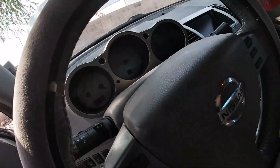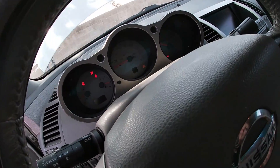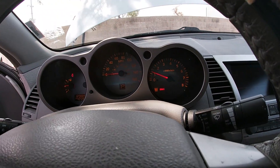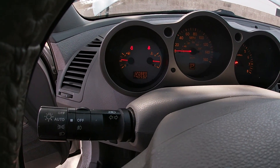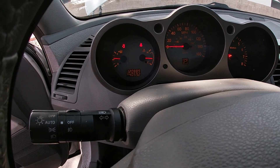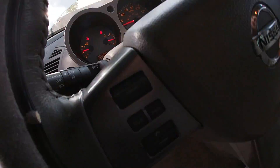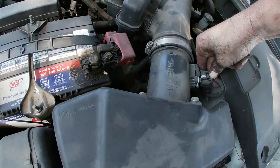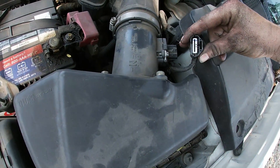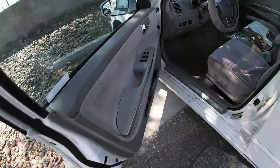You want to have your car running — let me show you here. We're going to have the check engine light on. You want your temperature to be at about operating temperature, so about halfway. Just let it run for about 10 minutes to get it good and warm. Then you want to disconnect the mass air flow sensor. What we're doing is resetting the learned air-fuel ratio by doing this.